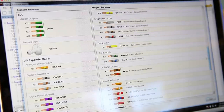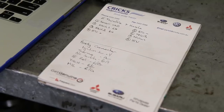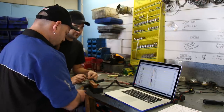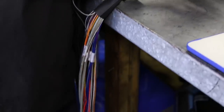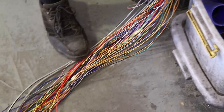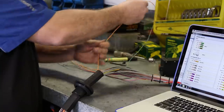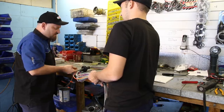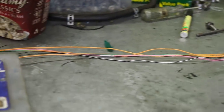There is no doubt that this is where things start to get complicated. Wiring up an engine from scratch requires planning and some careful note-taking. Modern ECU tuning software will often come with an IO diagram that helps you identify the wire colours. It's then a matter of connecting those wires to the correct sensor or controller. We're using an extended loom, but it's also possible to buy short patch looms where you can simply connect them at the factory ECU position and use the factory engine wiring in the bay.